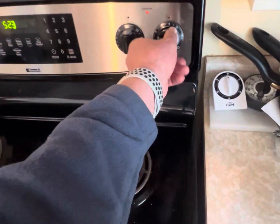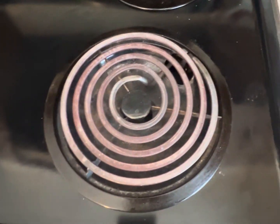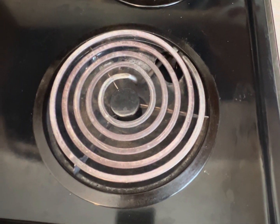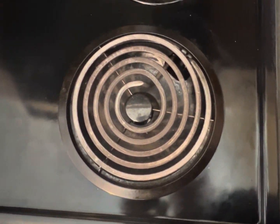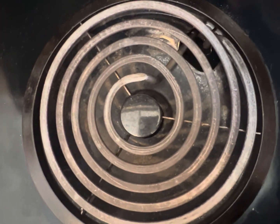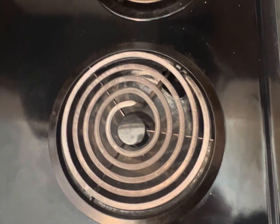Diagnosing: I turned on the burners and observed. Heating occurred without deviation and all burners responded to temperature changes correctly. According to the owner, the malfunction occurs randomly. Sometimes the right large burner stops responding to a decrease in temperature.